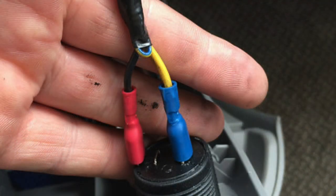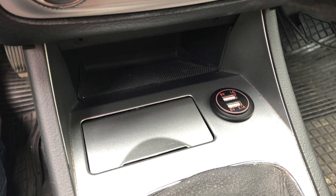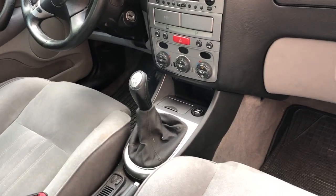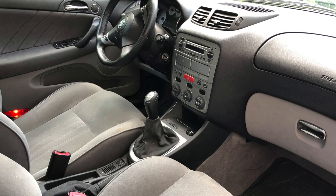If your socket doesn't fit with the new USB adapter you can just remove it and do it like shown in this picture. Just remember you don't actually need three cables — one of them you just isolate and tuck away. So here is the result. The USB adapter I ordered had two sockets: one port has only one amp and the other one has 2.1 amp. I'm actually recommending another USB adapter instead of this one — I will leave a link in the description for what USB adapter I do recommend.